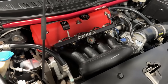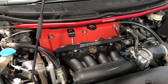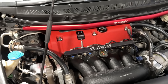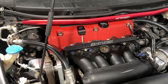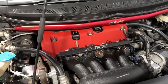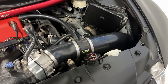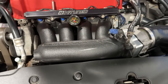This is basically a full bolt-on build. The owner swapped in a 2008 Acura TSX engine — the K24A2. Before swapping it in, he installed the 50-degree VTC cam gear wheel out of a K20 engine and also an RSX Type S oil pump that was ported to get a little more flow. Other than that, the engine is internally stock — stock 2008 K24A2 cams, pistons, and rods. The only internal upgrades were the 50-degree VTC cam gear and the oil pump.